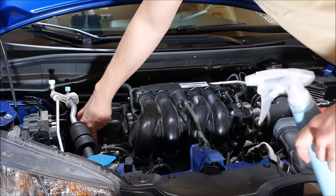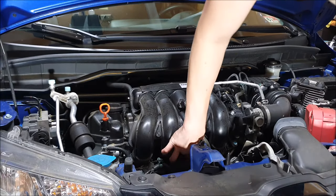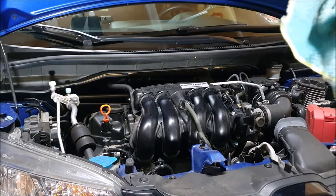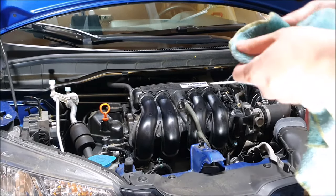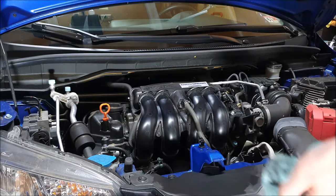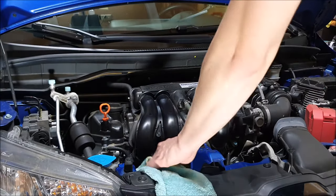For example, between the valve cover and the engine block in the Honda Fit, it's just exposed right here, so I just run my fingers along there and see if I see any oil buildup. Our engine's looking pretty good — of course it's a little dirty, that's normal. An advantage of doing this regularly is that if one month you see your engine's a lot dirtier, then you can try to track down if you have a leak somewhere or take it to a mechanic to help you. Hopefully this helped you guys — if it did, leave a like, click on the playlist on the screen to see my other Honda Fit videos, and subscribe. I'll see you in my next video.